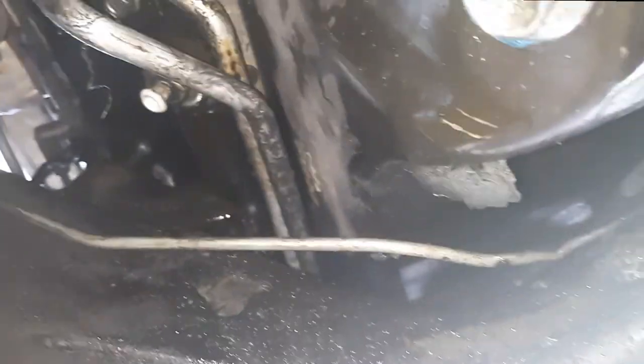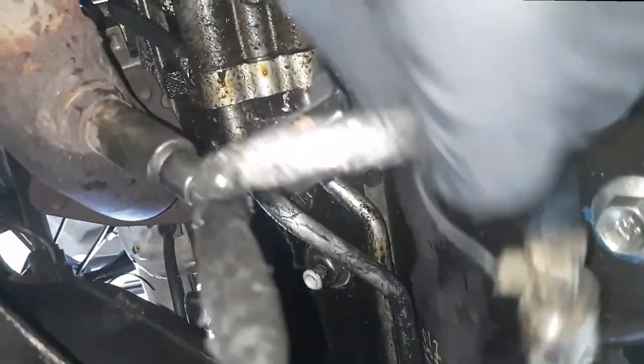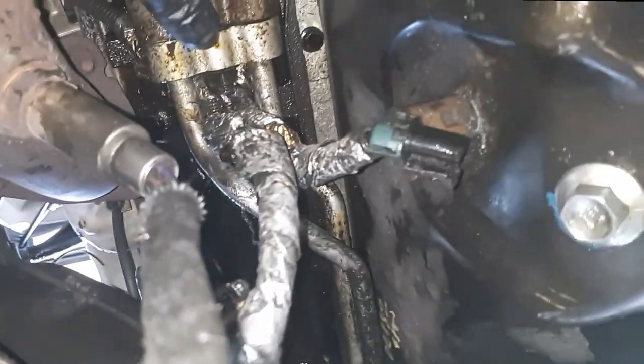So I made it this far — sensors are off: knock sensor, oil level sensor, O2 sensor. This is hard working under a car and through a camera. We'll pull our wiring harness and then pull our 15mm bolt up there and let her drain. We also got to find a bolt somewhere in that vicinity up there that holds the oil line cooler. Actually it looks like you can see it right there and it's not bolted back up. Let's get into it.